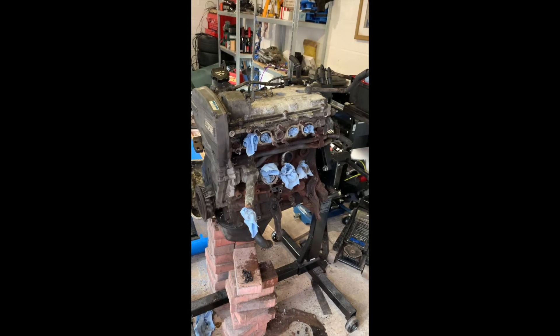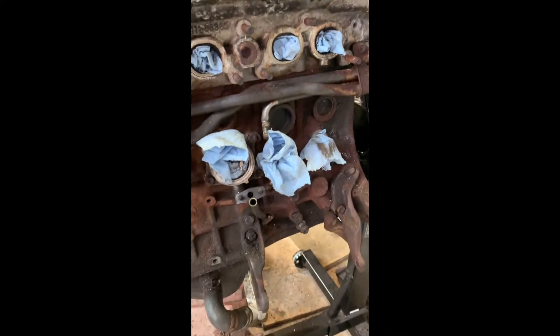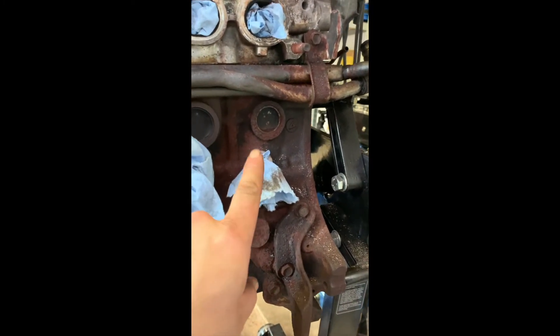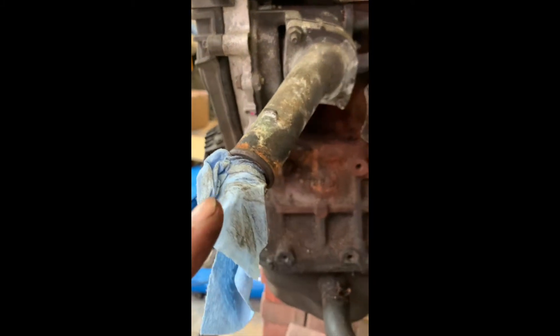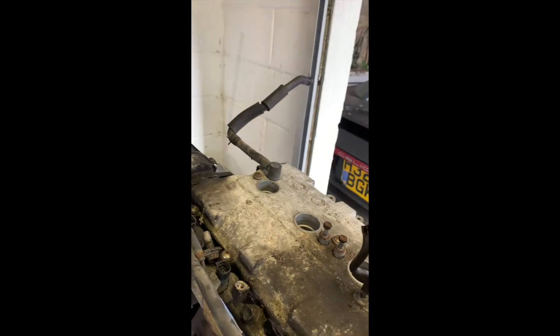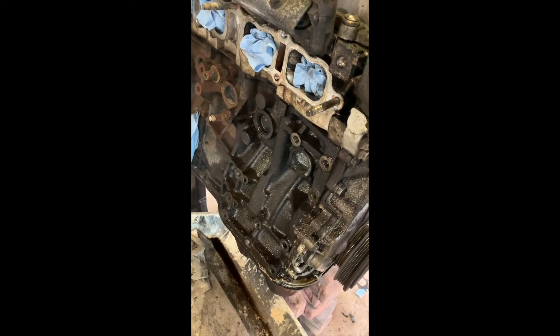Here's the completed article. I've removed the exhaust manifold, and there's one really large oil feed line from the block to the turbo, which then comes down through a hard pipe and connects back to the sump. I've plugged all the openings into the head, oil gallery, and water passages — same on the inlet manifold side. The distributor is still to come off, which might be tomorrow's job. I've hit everything with some brake cleaner to get the heavy sludge off and will follow up with a paintbrush and degreaser.